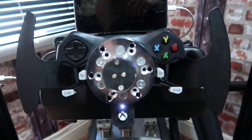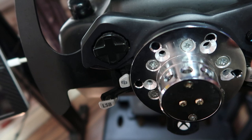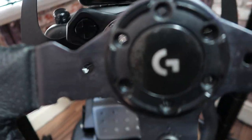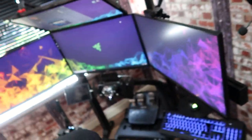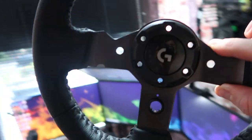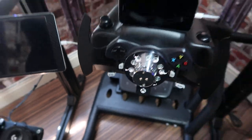This is basically what you clip onto. If you look at your original wheel, you've got your bolt pattern, which on this base didn't have anything that lined up. So you pretty much had to drill your own. If you don't have one of these to use as a template to mark the holes onto this back plate, what I suggest is you use a wheel, use these holes, use the back of this plate, get it dead centre, then mark the holes.